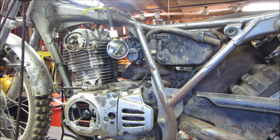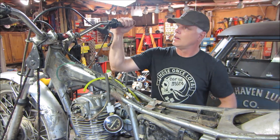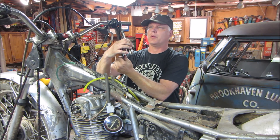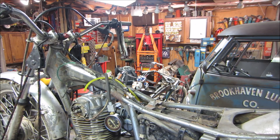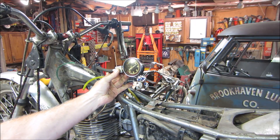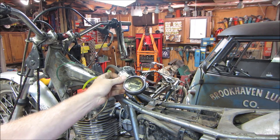Let me grab a clamp to adjust the throttle — I'm going to try a vice grip to hold it all the way to full throttle, and hopefully the vice grip helps hold it there. Let's see what full throttle gives us — you guys can read the gauge. We are right at 125 psi. You can definitely see the difference between the two readings, which is good — it means the engine came up even further.